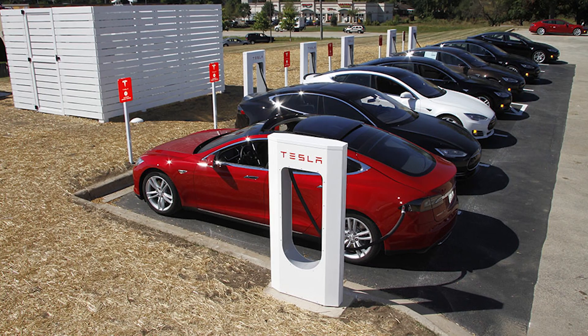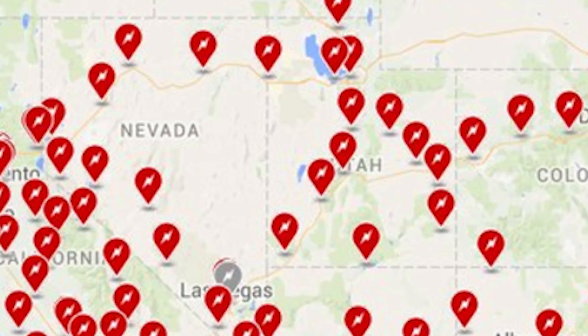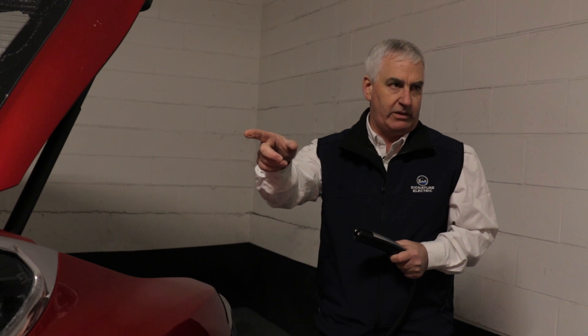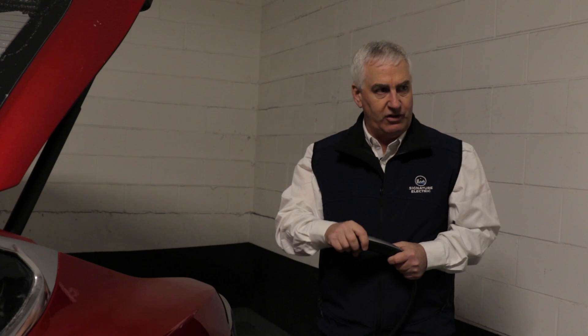These superchargers, at least for the Tesla ones, are all part of the system. If I set a trip in my car's computer — say to Palo Alto — it will actually design a trip for me, decide what the consumption is going to be, and route me through superchargers so I can make it at no additional cost. When you plug in, the car takes a moment to communicate with the charging unit — whether it's level 1, 2, or 3 — it knows the amperage, how it's set with the dip switches, whether it's DC-to-DC or 120V AC, and it couples with the car so it's charging at the right rate. It's not just a straight plug-in; there's communication happening as well.